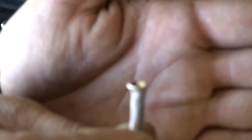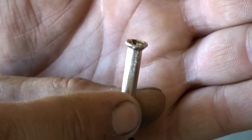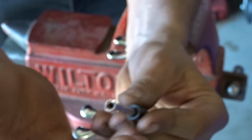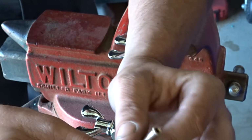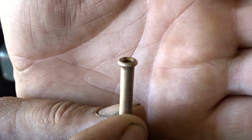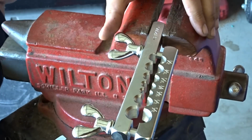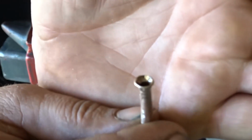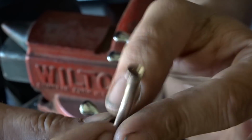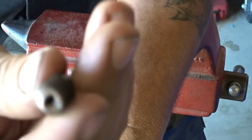I don't know if you guys can see that or not. It's alright. Not the best flare in the entire world. A little bit out of practice, but with more practice, you'll get better and better at it. And hopefully one day you can make a nice factory double flare, because that was the factory end portion of this tube before we decided to try to make our own double flare, which didn't come out as good, but it still holds its purpose, holds the fastener, and how we had this turned around, it would most definitely work.